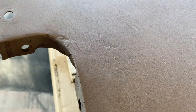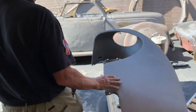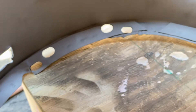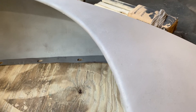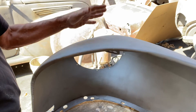There are areas where the factory pinched and welded, with a lot of leading back in those days — if a stamping wouldn't come out of the mold they'd lap, weld, and lead it. These flat areas are less sensitive and can be straightened with a hammer and dolly if over-blasted. But the rounded areas are very sensitive to overheating from a sandblaster. A siphon blaster is harder to create that heat, but with a pressure blaster it's very easy and common to get too aggressive — too close or at 90 degrees — which warps the outer metal.